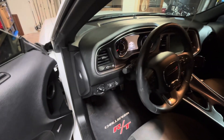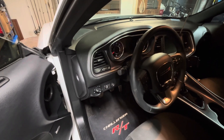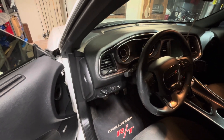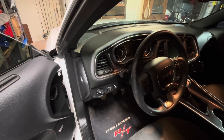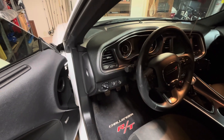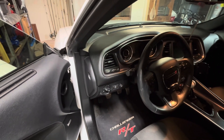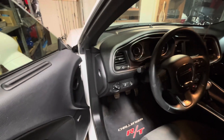At the end, we're going to reset our oil life indicator. I don't drive this car a lot of miles — we're nowhere near the mileage requirement. I've only driven about 1,500 miles since my last oil change, but that was almost a year ago. It's important to keep fresh oil in the car long-term because oil goes bad — it collects moisture and doesn't lubricate as well. You need to change it at least once a year, even if you barely drive it.